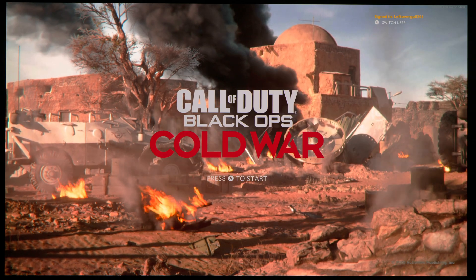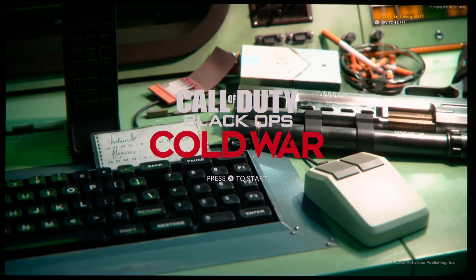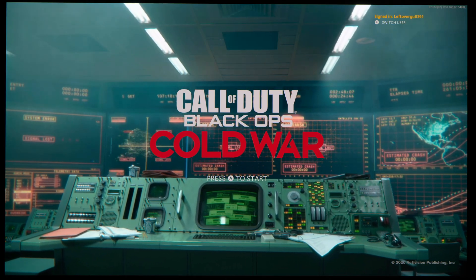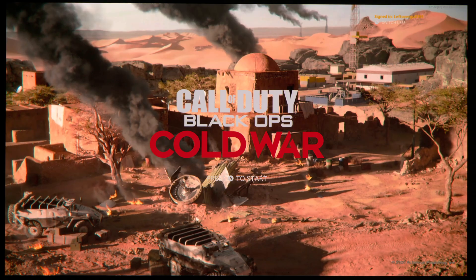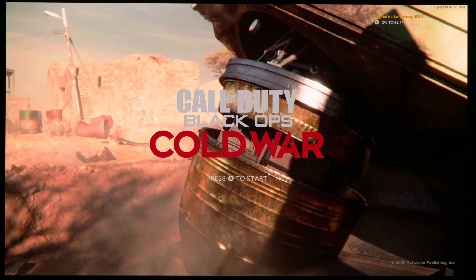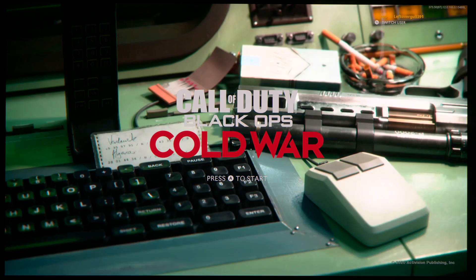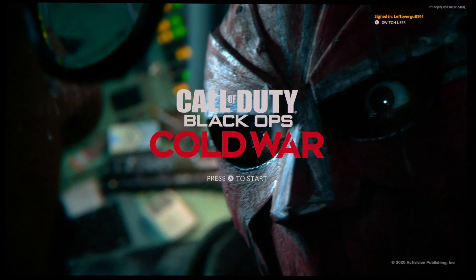One caveat to mention is that currently we are only using the HDMI 2.0 signaling method of TMDS, because the Leo Bodnar 4K lag tester is only HDMI 2.0 — they haven't come out with an HDMI 2.1 version. I don't think there are any commercially available lag tester devices with HDMI 2.1, besides maybe the upcoming Murideo 8K signal generator, which I'm keen to get my hands on. Until I can get a true HDMI 2.1 lag tester, I can't test the HDMI 2.1 FRL fixed rate link signaling for input lag, but I would expect it to be the same — it won't add any input lag, so you can enjoy all your games in a responsive manner.